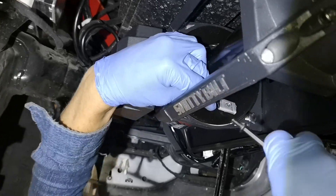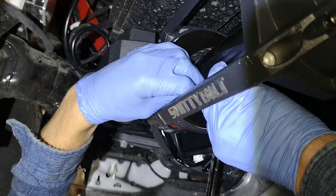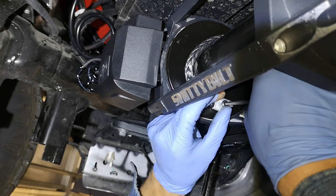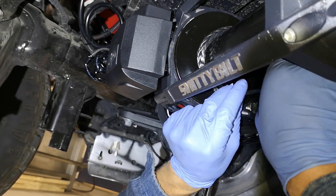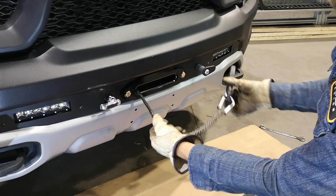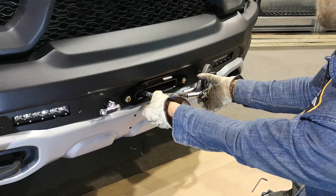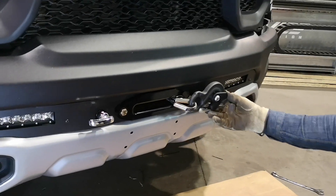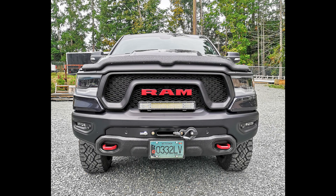Lastly, if your winch doesn't come pre-spooled — such as the Smittybilt X20 series — attach your winch line now, keeping in mind the winch spools up and over the top when drawn in. Wire the winch control box to the battery, then spool the winch following the manufacturer's instructions. Finish by sliding the winch hook over the hook retainer, being very careful not to pinch your hands or fingers between the hook, line, and bumper. Before marveling at your work, check all critical fasteners to make sure they're tight. Congrats, you're done!